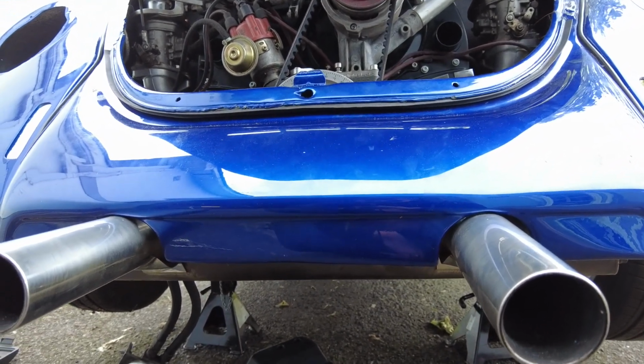The next thing I'm going to do is a little bit of cleaner work. I'm going to sort out the electrical wiring in the car that leads down to the engine, because there are two power supplies that are not there. One is the supply to the alternator, basically the supply that excites the field windings in the alternator, and the other is the supply to the coil.